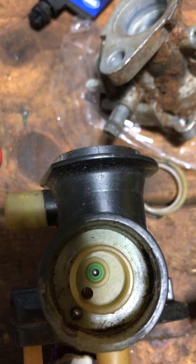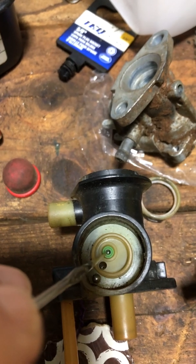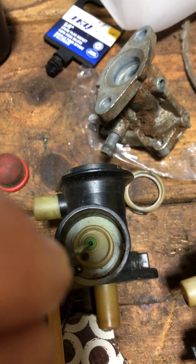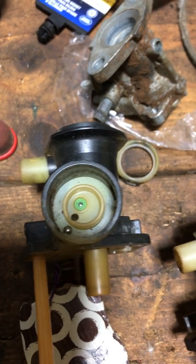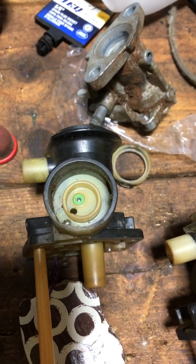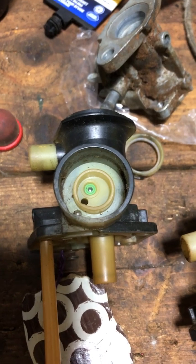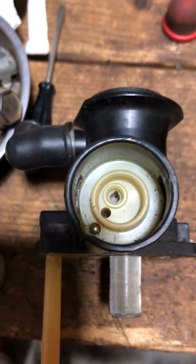If you look underneath, this is what you're going to find with one that's complete. I haven't done anything to this one because it checks out. One of the ways I check that is to go in with this little probe here and make sure that this moves up and down — pushing, pushing, pushing — and it does, just like when you push the primer bulb, which then shoots fuel through that area. You don't want fuel leaking out all the time, and that's what the spring does: the spring is forcing that ball bearing against that needle seat all the time, until you push it to free up the fuel and shoot it into the opening of the manifold. So here's what's underneath the primer bulb with all of that.